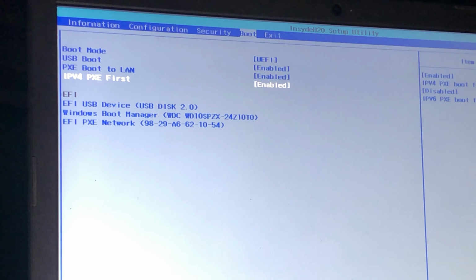So you have to choose the advanced mode. You can see here there are a few disks available. If you want to delete any disks, you have to come here and delete this one from here. There are a few options: refresh, delete, format, load driver, and extend. Okay, so I'm going to delete everyone. I think this is the primary device, and I'm going to delete this one, or you can format also. So I'm going to format this one.